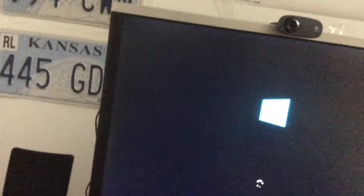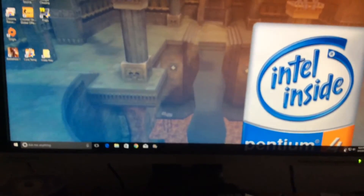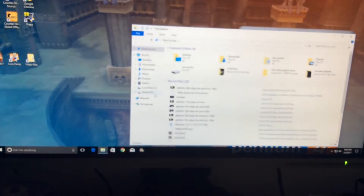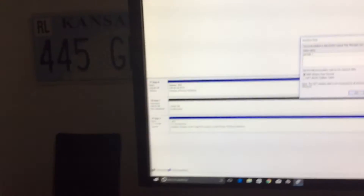I'm going to format the drive. Thank god it actually picked up, because usually most hard drives you pull out of a DVR are locked. I'm also going to check the SMART data on this hard drive just in case it's failing, but mostly it shouldn't be — AV hard drives are pretty good when it comes to reliability. If we go into Disk Management, under foreign hard disk partitions, we should see it right here.